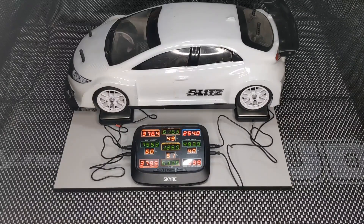There's some difference in weight between the two cars — if anything, that one probably needs a little bit more ballast just to be safe. Looking at the weight distribution front to rear, which is the thing I'm most interested in, the difference is quite dramatic. The 21 car has only got 60% of its weight over the front axle, compare that to 68% with the old front motor car, and of course 40% therefore over the rear axle. So what we'll be interested to do now is spend a little bit of time with the wrenches and get the heavy 170g ballast weight onto this car and see what effect that has.